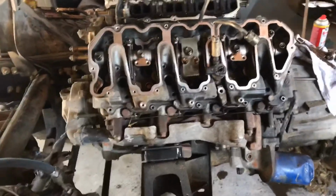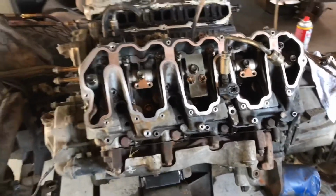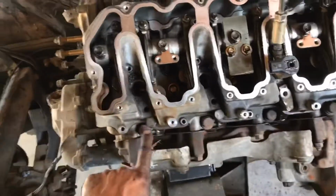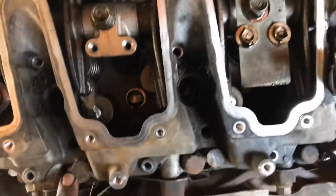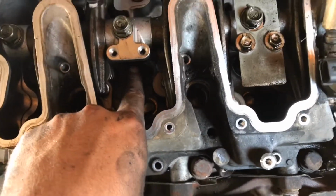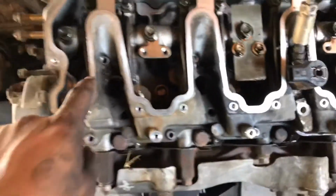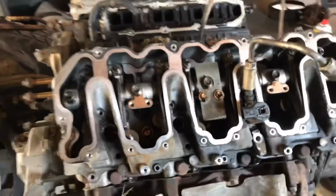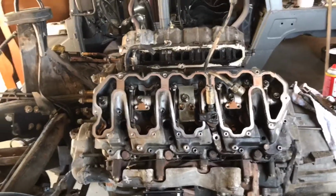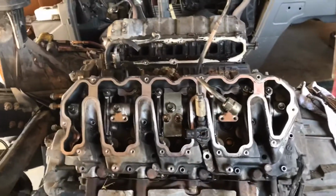because without removing that injector, I cannot remove the upper valve covers, and I cannot remove the cylinder heads. The outer bolts right here are accessible, but the other bolts, I don't know if you can see, there's a bolt right in there, right between the rocker arms. And there are also other bolts right over there. Those have to be removed in order to get the cylinder head off. So I'm kind of stuck right now. Let me do some research, see how I can get those injectors off,